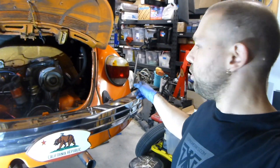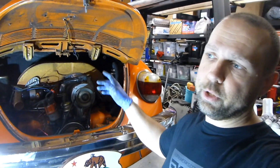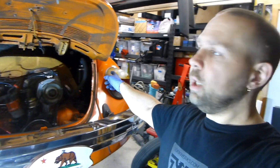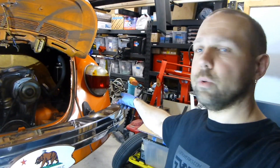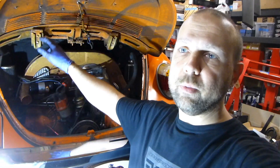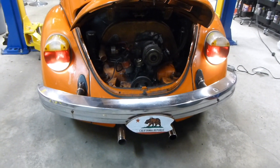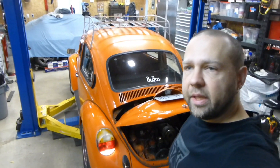That's the diagnostics I used to find why the reverse lights don't work. It's a very basic circuit: power from the coil goes to the switch, the other side of the switch goes to a Y connector sending current to the two reverse lights, and the coil gets current from the front through that inline fuse. And there we go — the reverse lights are working.